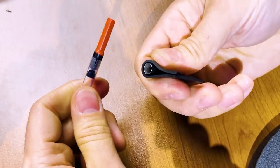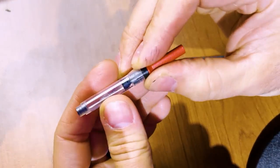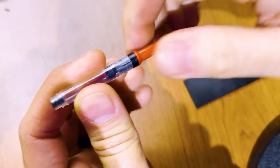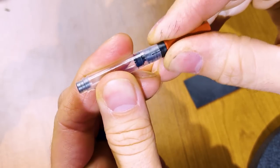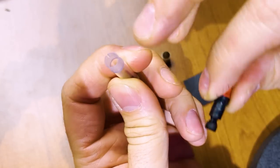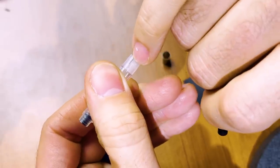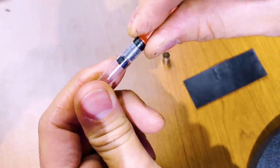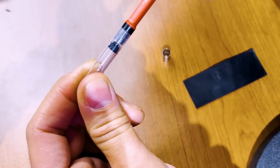That metal shroud is not just cosmetic — it's actually functioning. It holds some stuff in place. As you can see, once it's off, the mechanism comes right out. It's friction fit with three notches where the plastic bends just a little bit and holds on. There's a little raised portion that fits in and grabs the converter. Then when you have the metal shroud over top, that locks everything in place — like a plumbing P-trap with little grippy rings. It's a pretty elegantly simple design.